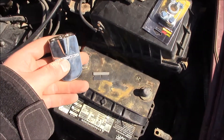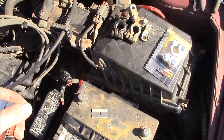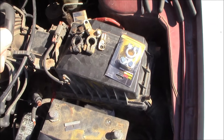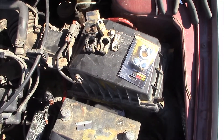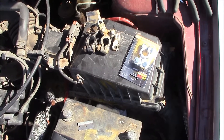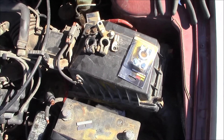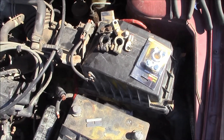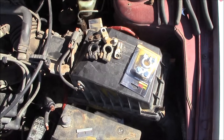When you install the positive terminal, make sure you have your amplifier wire either attached to your amplifier — which I'm not a big fan of doing because if the amplifier was shorting it would fry it — or have it in the trunk wrapped in electrical tape so it doesn't hit something metal in your trunk and pop the fuse, or worse yet catch your car on fire.